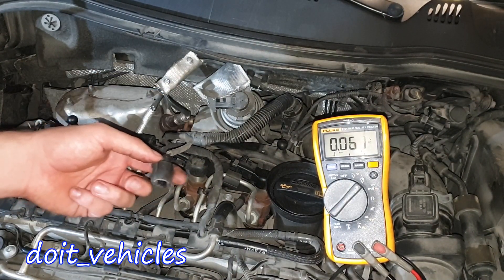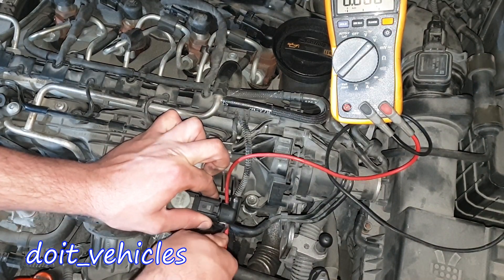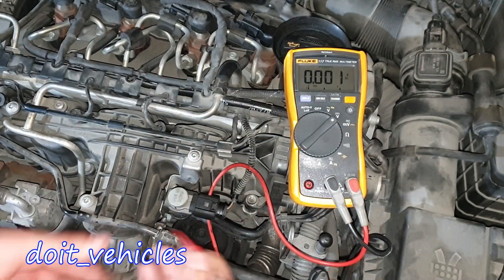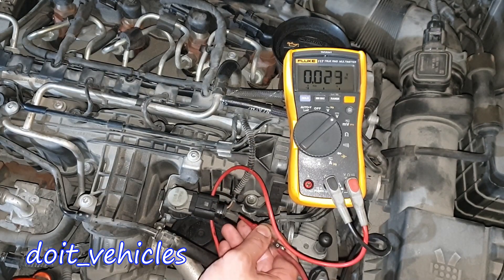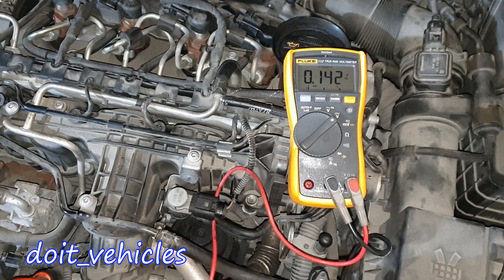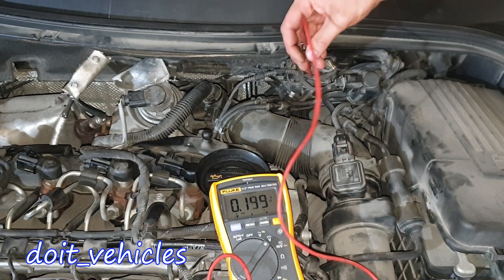Next I'm going to plug in the connectors on these three electronics and see what values we find when the connector is on. The black terminal is connected to ground, so we're going to see the signal here. We've got 0.1 volts on the first pin from the right, so 0.15 volts on this black wire. The brown wire has the battery voltage again, which makes sense. The reason I'm doing this test with a voltmeter is because that's what most people will have as a scan tool.